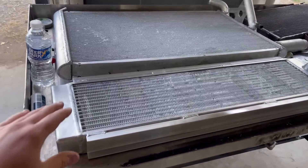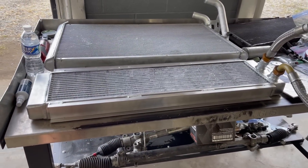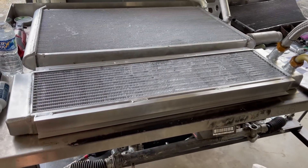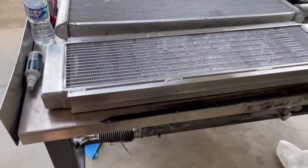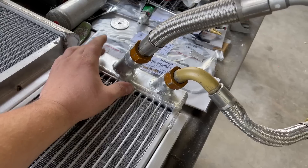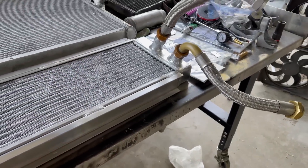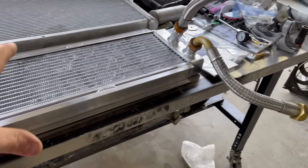Check it out — here is the custom oil cooler for the Ferrari 599, built by Bell Intercoolers. We shipped off our unit, they made drawings of it, and custom fabricated it 100% brand new. They also had to CNC mill these end pieces because we couldn't get them off the original — the original uses much thinner aluminum, so this one is a bit thicker and stronger. They also pressure tested the lines, so this thing is almost ready to install.